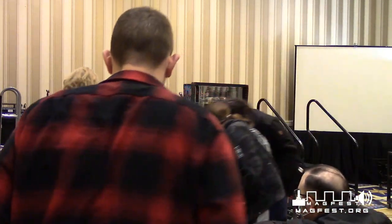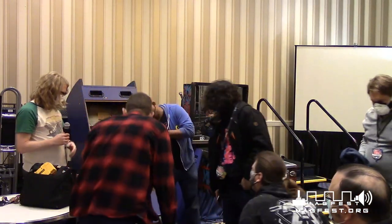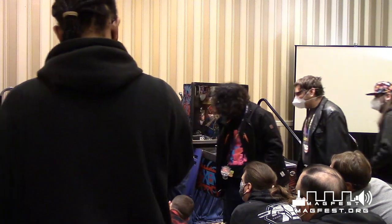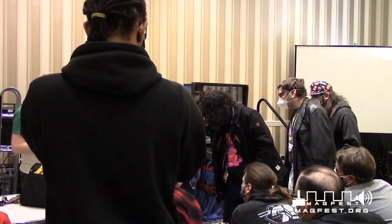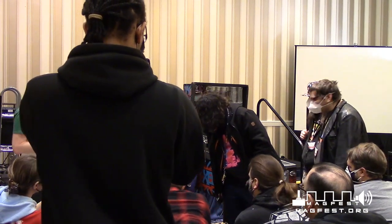If you see any dead animals in here, like that cricket right there, don't worry about the cricket or dead mice. I've seen those before, too. But yeah, this is the game board. This is giving everything that goes onto the screen. Like I said, the anode here is what I was talking about, that getting shocked. This needs to be discharged.